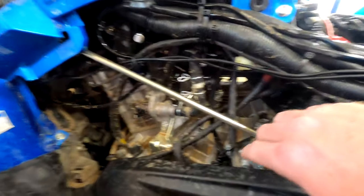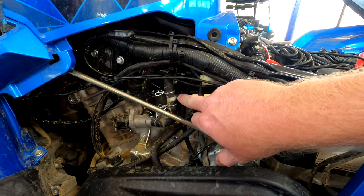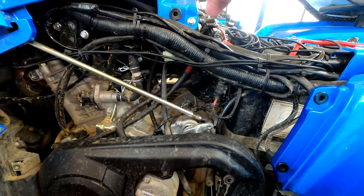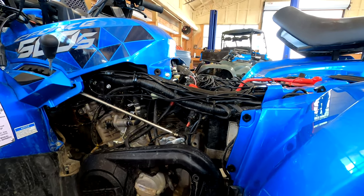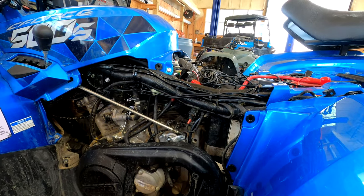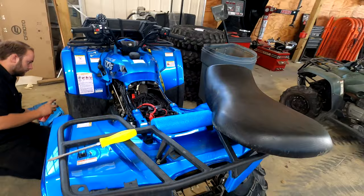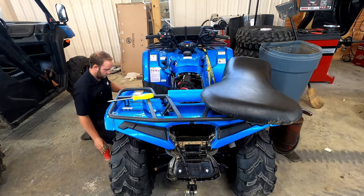Just an overview: the 500 and 400 are mapped out exactly the same. To review — we took this vacuum hose off, and it was almost like a closed-loop system where you had the vacuum going to the canister and your vent line off your tank going to the canister as well. It just didn't breathe right on the bottom of that canister — just poor design. But now with that deleted, which CF Moto is allowing you to do, take it to your dealership and get that problem fixed. You shouldn't have any more running issues — everything else on the 500 and 400 has been awesome.